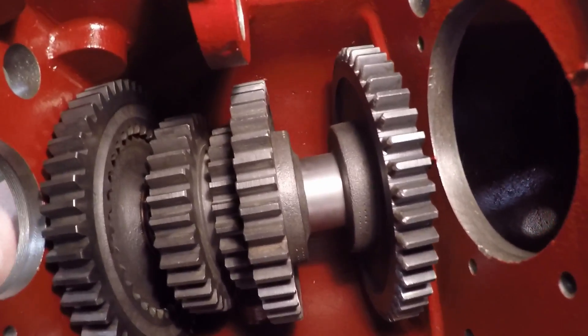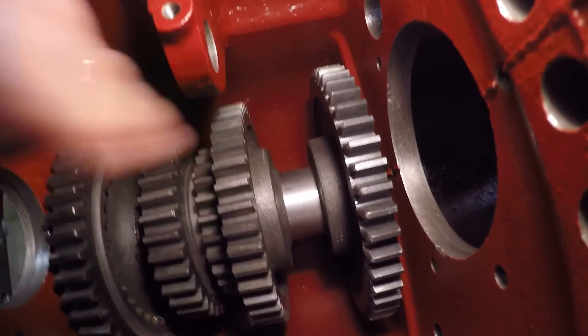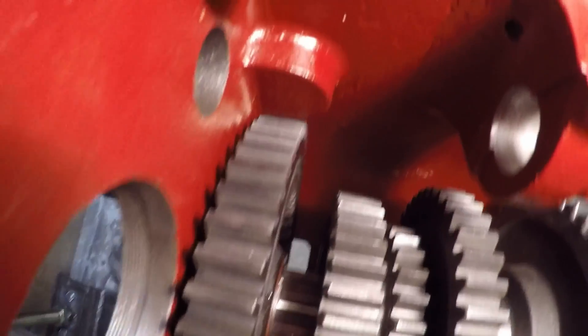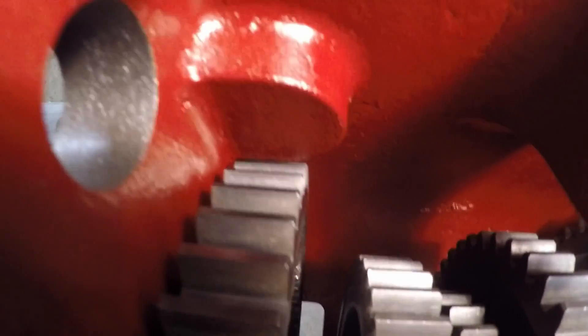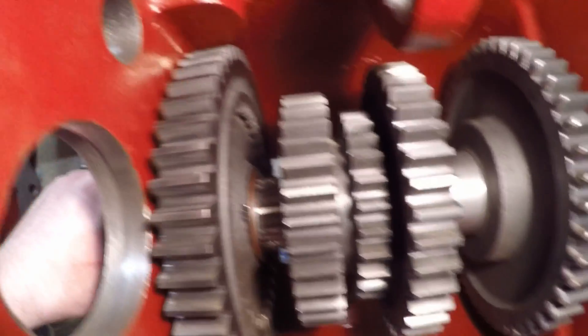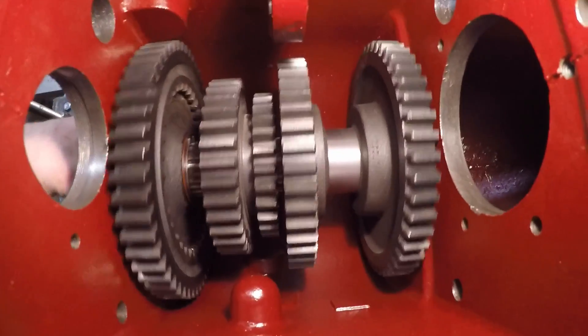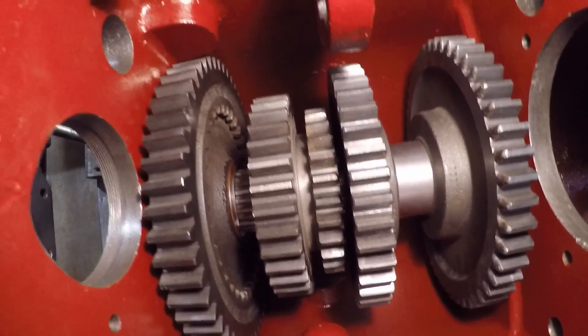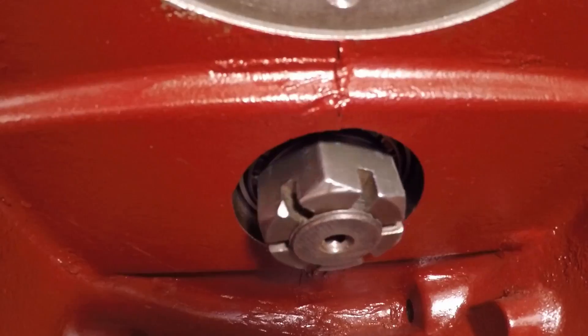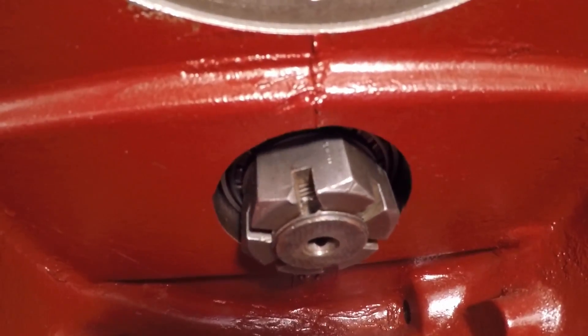The spacer is working out just fine that I made. I don't know if that's going to cause me a problem in the next video when I fit this upper sliding gear shaft — I will explain my concerns with that then. One thing I want to show you is just how crazy close they run that first gear to that case boss right there. I know that's less than 20 thousandths clearance on those teeth, but I have pulled and pried and I cannot make that thing contact — that's just how they run these gear cases. It's also why you want to have good preload on the shaft. I've got a nice rotational torque on it right now — easily meets spec — and that keeps this whole shaft centered on its axis so it cannot float around and allow that gear to get any closer to that boss. And I've got excellent alignment with the cotter pin hole in that castle nut up there for that front bearing, so I can secure that in place when I'm ready.